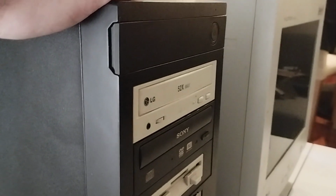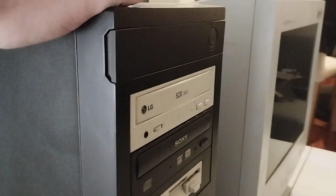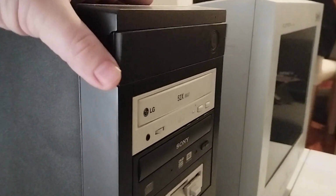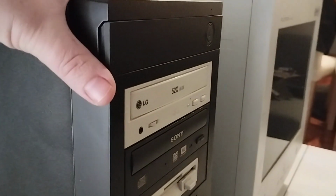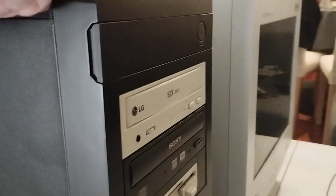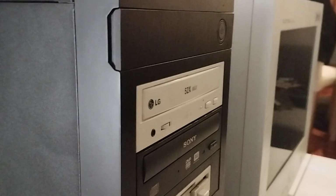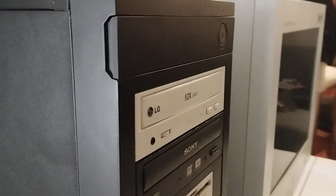And also I changed, well, it has an onboard sound card, but I don't like that, so I put there a Yamaha YMF-719E or something like that. The thing is, it's a Sound Blaster Pro compatible card, but it has an OPL3 chip, which is a very good chip to have. Some of the Sound Blasters, which I could have used, I have a couple there, do have OPL2 and OPL3 chips, but most of them, not easy to find those, so I end up using a Yamaha YMF-719E with a proper OPL3 chip. Yamaha is the one that made OPL chips, and that's what I used.